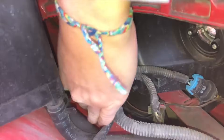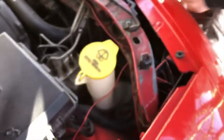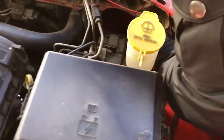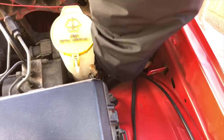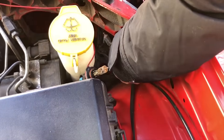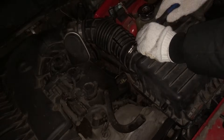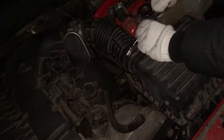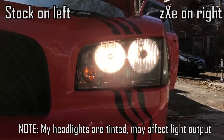If they're not fitting perfectly, it helps to look into the headlight area and see where it should be aligned. Access to the bulbs on the other side is even easier — you don't have to remove anything and can just reach in and repeat the whole process. Make sure to also put back the intake, plugging the hose back in, fitting the intake over the clamp and tightening it, and putting the bolt back in place.